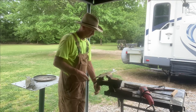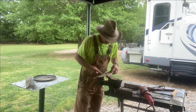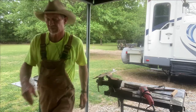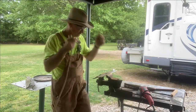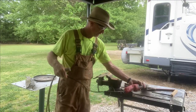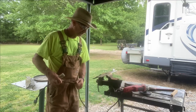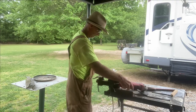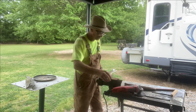I'll put my blade in this vise. You only do one side of the blade — sometimes I have to flip it over. I always make sure to put safety glasses on because a piece of the blade or the grinding wheel will fly off and get you right in your eye. My dad got his eye put out when he was about 15 years old, and trust me, I got preached to all my life about protecting my eyes. So when you're like me you put your safety glasses on, then put your regular glasses on over them.